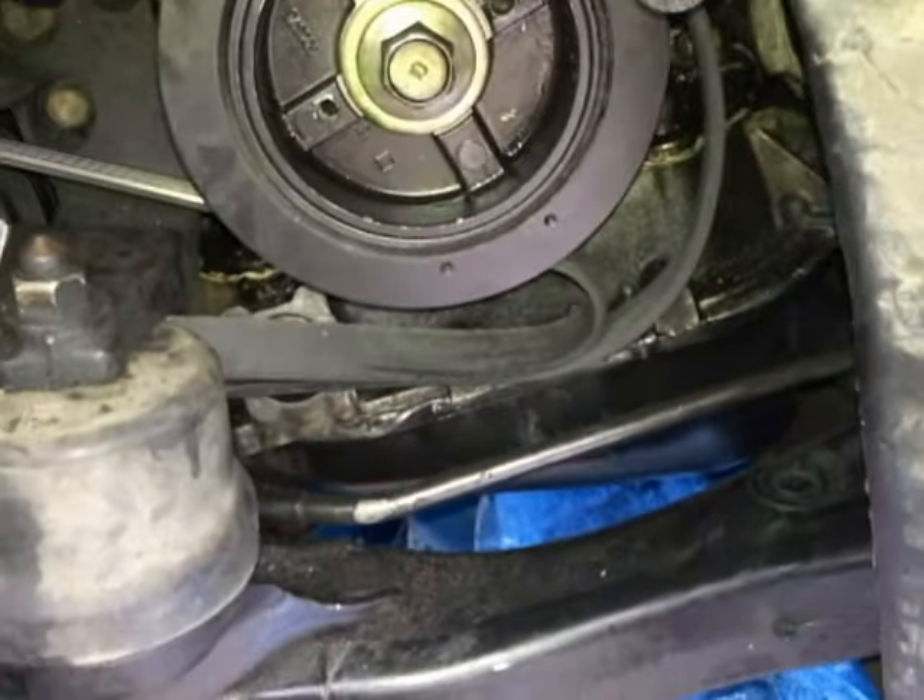I took an extension and just pushed it through there — through that little loop — and locked it in on the control arm right here, and then up here. So what happens is once you start turning it: now this is a 2002 Toyota, the drive shaft is going to be going clockwise, so we're going to be turning counter-clockwise with the bolt.